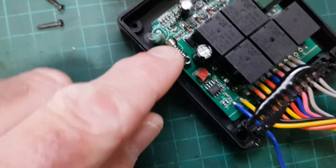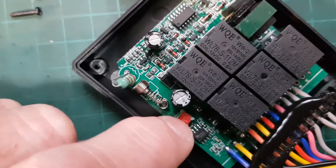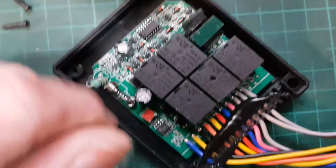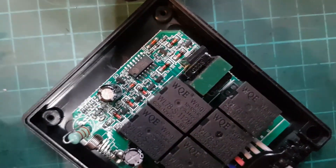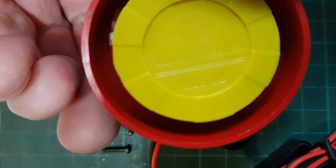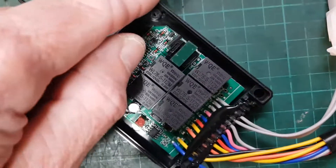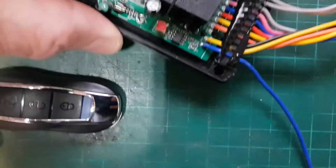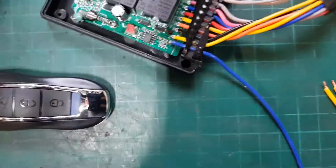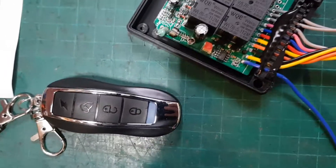The actual sensor is this little spring here — a spring-loaded weighted spring — that's what makes the alarm trigger. There's a little trimmer pot which might be for antenna tuning. There are quite a few relays inside and what looks like a little transformer winding, probably for the high voltage. It says 100 to 125 dB and I can believe that. The cables going in are sealed but all the way around the case it wasn't sealed, so this is not waterproof — you need to protect it or take it apart and seal it properly.